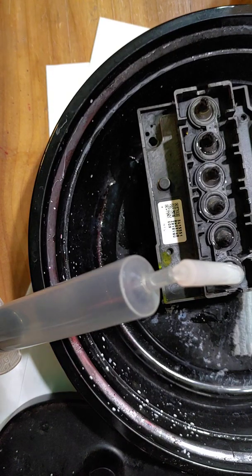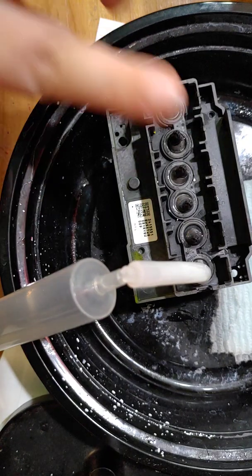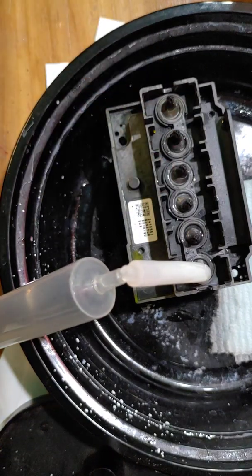You know, it's just one of those things where sometimes you're successful and sometimes you're not. I don't give up easy. I had another printhead that I put into the L1800, so it's printing right now, doing its thing while I work on this printhead. So a good lesson is to always make sure you have an extra on hand along with extra dampers. Before you assume that you have a clog, always assume your dampers are bad, because those will go out way before your printhead will.